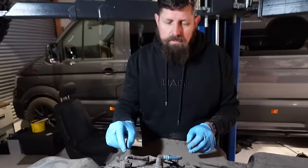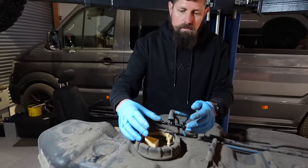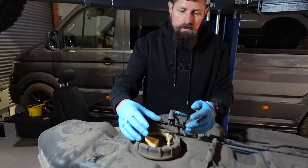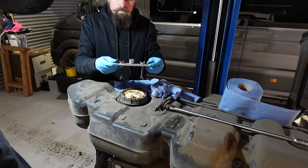We're going to tap into the fuel sender. Before you take the sender out and before you disconnect the pipes, take a quick photo of how it is and how it all goes - these can potentially connect up the wrong way. Also, the sender once removed can turn and be put in a different position, so take a photo so you remember exactly how it goes back.